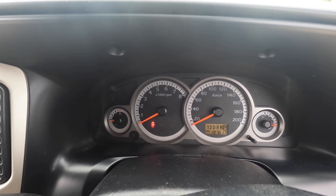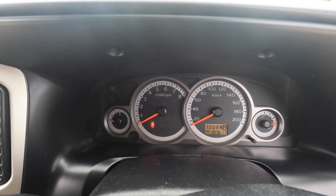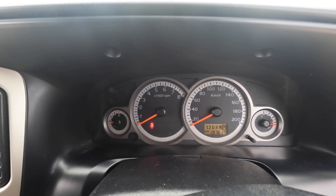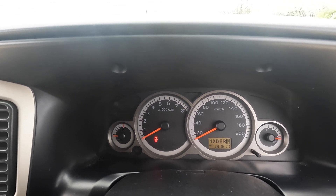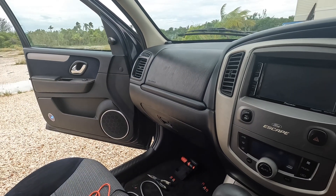You can't hear the fuel pump startup — there's nothing. It's just dead. Rechecked everything, checked all the connections, couldn't find anything. Checked the fuse box in the engine and all the fuses were fine. Then went to the fuse box down in the footwell and found a blown fuse.